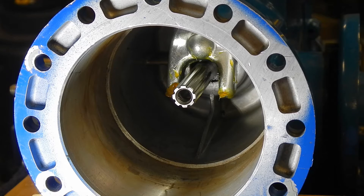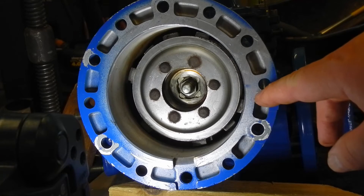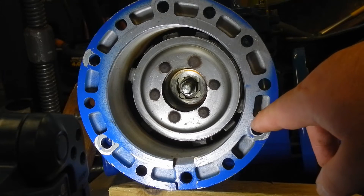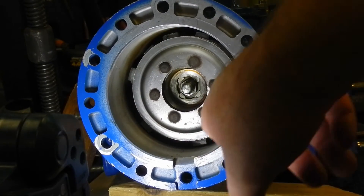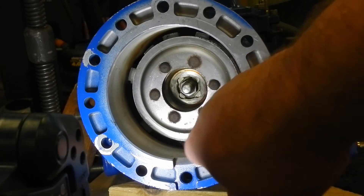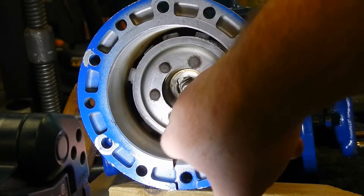This is the clutch end. I've cleaned everything up and applied fresh grease on the rubbing surfaces, and so now it's time to put the disc clutch back in. I think I've got the clutch on correctly now. There will be a challenge before I put the engine on — I'll have to get all these projections that stick out from the clutch discs lined up so that the slots on the half that's connected to the engine can fit over the outer portion.